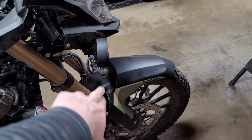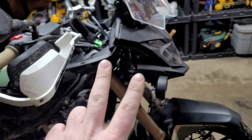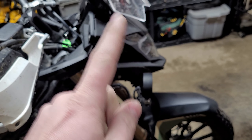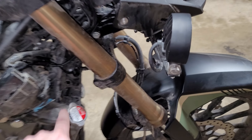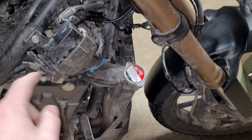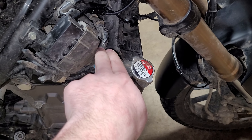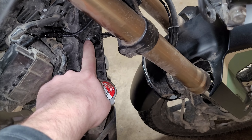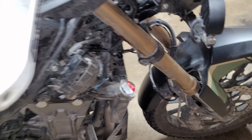Inside the cable to your sensor there are two wires: a blue wire and a white wire. It doesn't matter which one you cut — cut one of them, run one side to the switch, then the other side of the switch back down to the sensor. Make sure you're cutting into the ABS sensor wire and not the wiring loom side. Wiring looms are a nightmare to repair — cut into the sensor wire, not the several-hundred-dollar wiring harness that requires complete disassembly to replace.